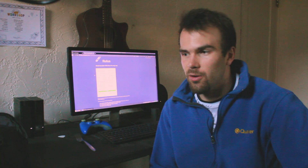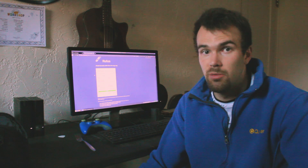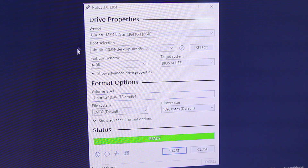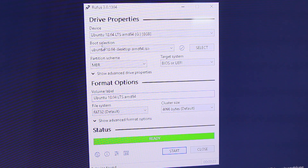The ISO turned out to be a little over a gigabyte — download time depends on your internet connection. Once it's done, pick up that empty flash drive and use Rufus to create the bootable device. Rufus brings up a menu where you select the ISO under boot selection, make sure it's set to MBR, then most settings are generic — FAT32 is okay, 4096 cluster size — and then just hit Start. Hit the power button, get everything fired up, and remember on a Dell Inspiron it's F2 to get to the BIOS.